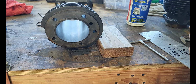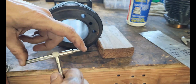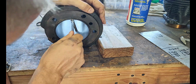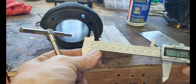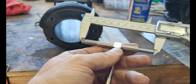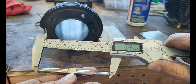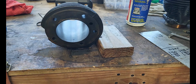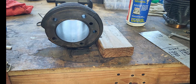See, now that last one being 10 thousandths bigger than the middle, that kind of makes me wonder whether my gauge was snapping right. So we're going to retake these two. There's a tight spot there in the middle. Okay, that's what I was thinking. So that middle one comes out to 3.462. So I got a little tight spot right there, and it's knocking that back in.